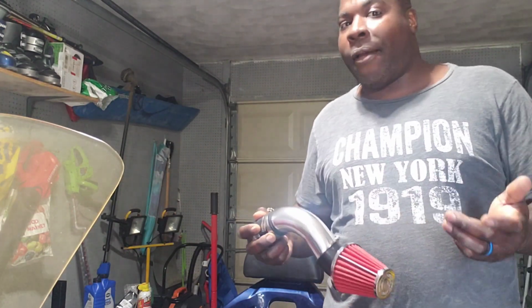There's one more of those in the kit that's a little bigger than a 16. I think it's a 19 or 20. We could use that to give us some more fuel inside, and then we have to do adjustments. Every time you change something, you have to adjust all of that stuff. We have to retune it. If you put more jets in there, you've got to retune it down so it doesn't give too much fuel or be too lean.